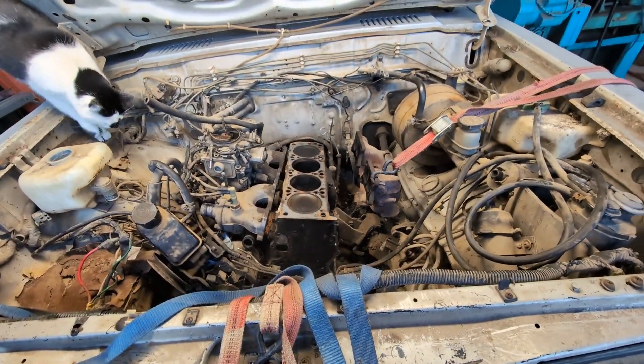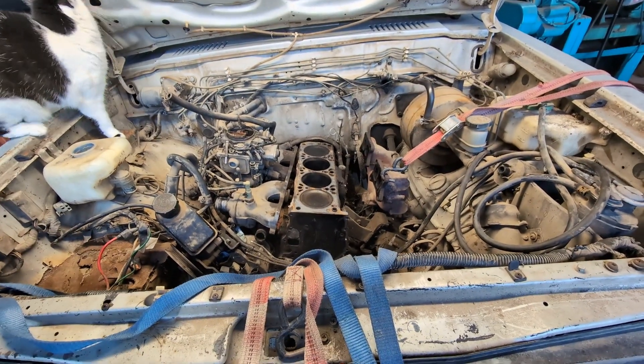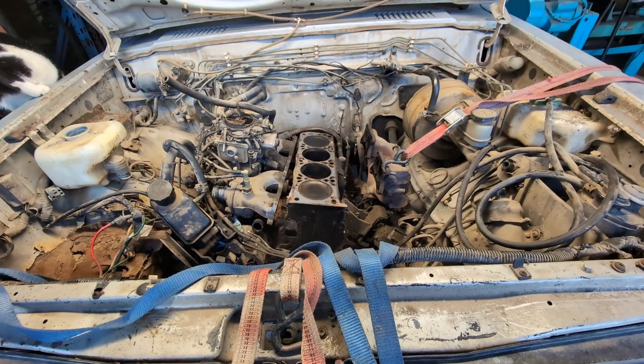Where I sit with this — I was looking at getting just a cylinder head, but I'm into it this far and have things unbolted from the engine block. It just makes sense to pull the block out of there, flip it over on an engine stand, and check the bottom end bearings to see what I've got.